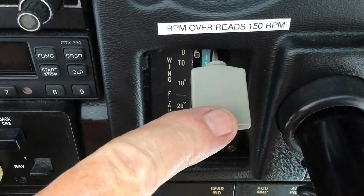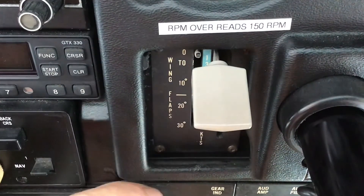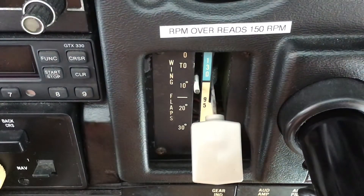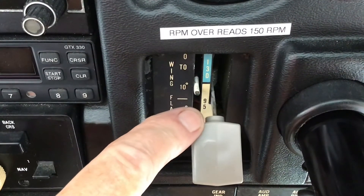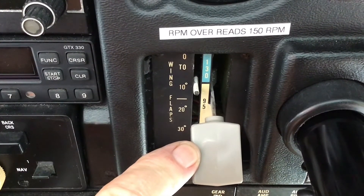This is the cardinal flap switch and as we all know, 10 degrees of flap is recommended for takeoff. If we lower the flap to 10 degrees, there's the flap follower coming down showing the flaps have gone down to 10 degrees. On this blue bit of colour here it says 130 — this means that we can lower flaps on the cardinal at 130 knots.